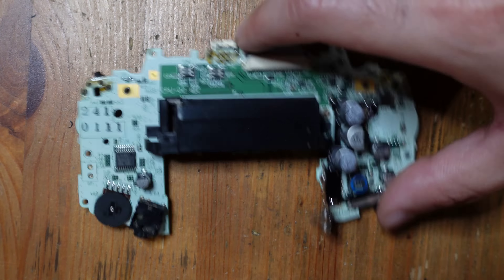Now we're going to turn our attention to the front of the Game Boy motherboard and install the Clean Amp Pro. This is the amplifier, and it goes right here in place like this. This one's really not that difficult to install either — you just solder it into position on all of these various points, and the speaker is going to go here on these two pads.